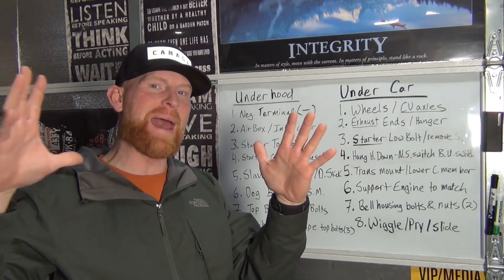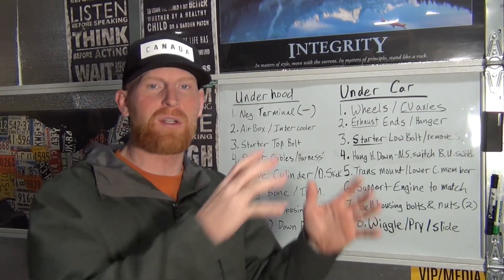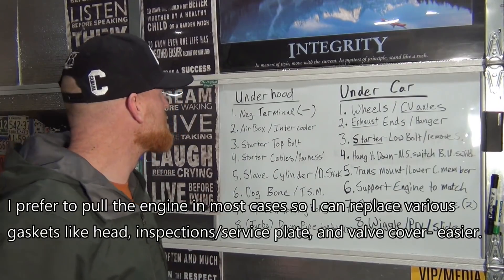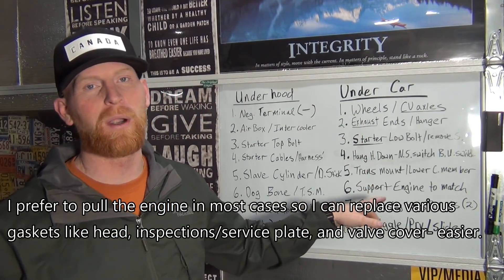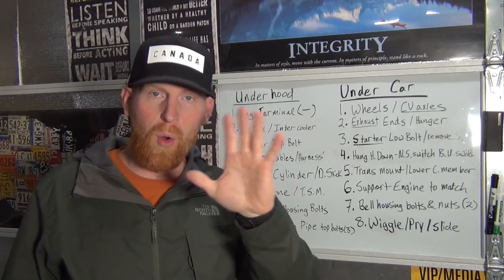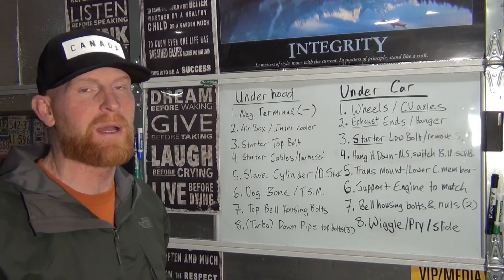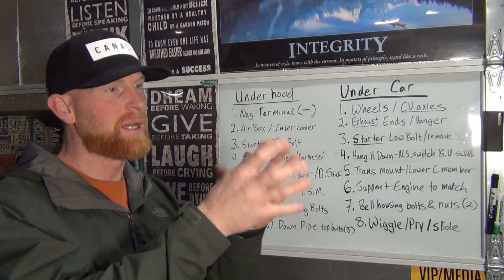To do it this way — pulling the transmission back but having it hang up in the car — is what we're going to talk about today. All of this is related to getting the transmission back to change the clutch on a Subaru. I'm going to go over quickly the way I do a clutch on a Subaru going that route of pulling the transmission back and having it sit on the crossmember. I have two phases: the underhood part where you're up on your feet, and then the undercar part. I try to get everything I can first under the hood, because the first step is doing the negative battery terminal, and then the rest is undercar. I have a whole separate video that shows the actual process of doing this — I'm going to leave that in an end card, along with a playlist.